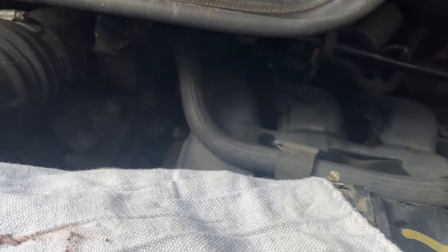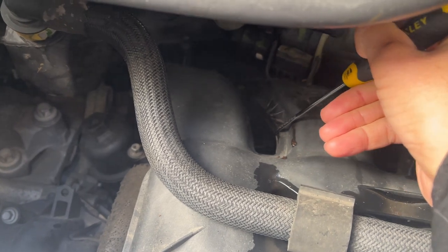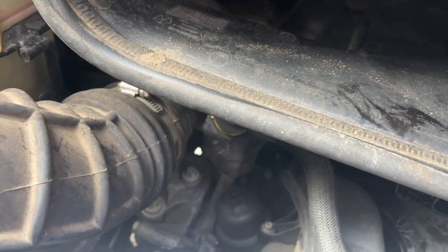The problem is this is so poorly engineered — the bolts sit on top, water gets in there and collects, and those bolts get so rusty and hard to remove that in a lot of cases they have to break that giant plastic piece on top to get into it and then replace it. We are going to try to do it ourselves — that's a big question mark. We're going to open it and check it out and see what the situation is. If not, we'll take it in. So we're waiting on a quote from the Dodge dealership, ordering parts, all that fun stuff.